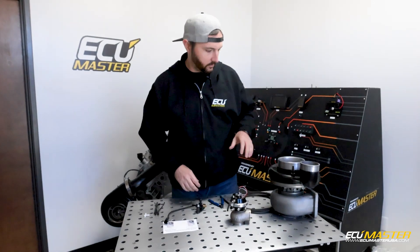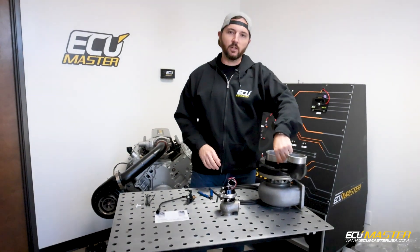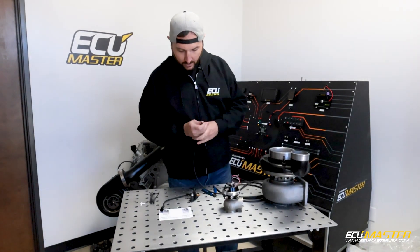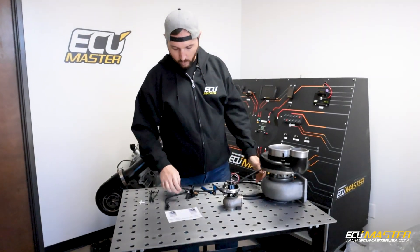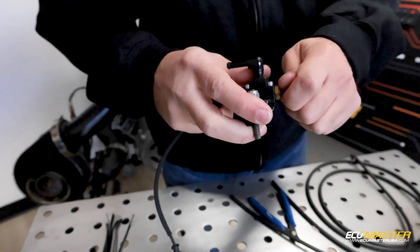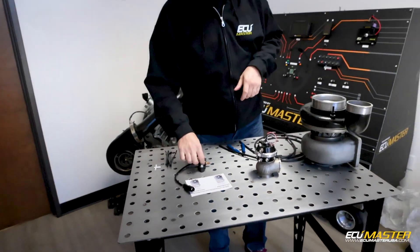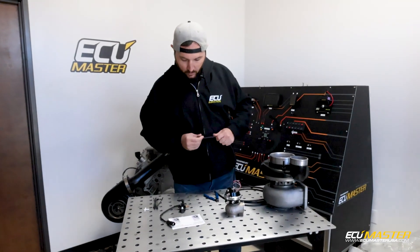So we're going to route it. This is the compressor side of the turbo. When you're in boost, there's pressure here in the compressor housing, so we're going to use that as a pressure source. Looking at my diagram, for an external wastegate, port one gets a filter — a sintered bronze filter just to keep dirt out of the valve. Not wildly critical, but long term, keeping junk out of there is great because you can see how dirty this gets in application.